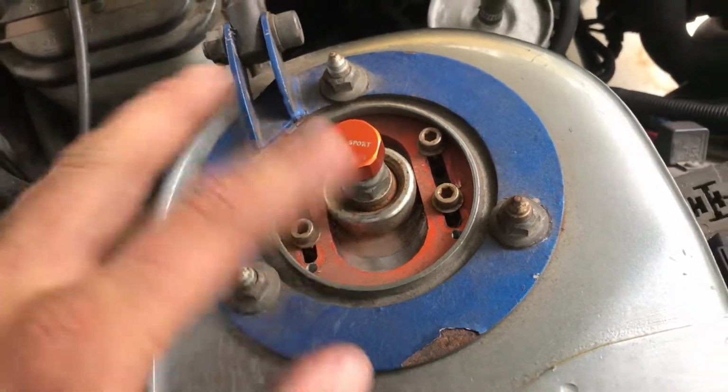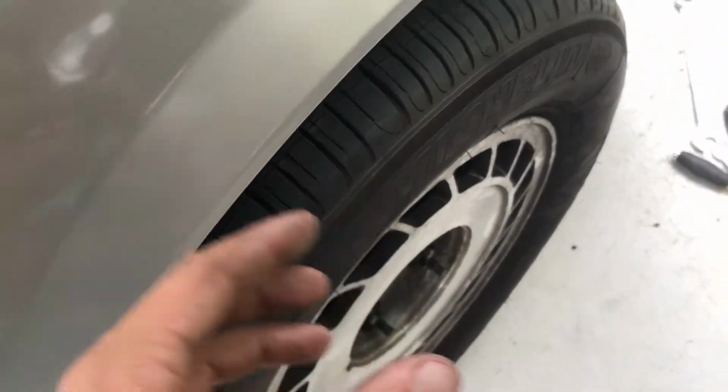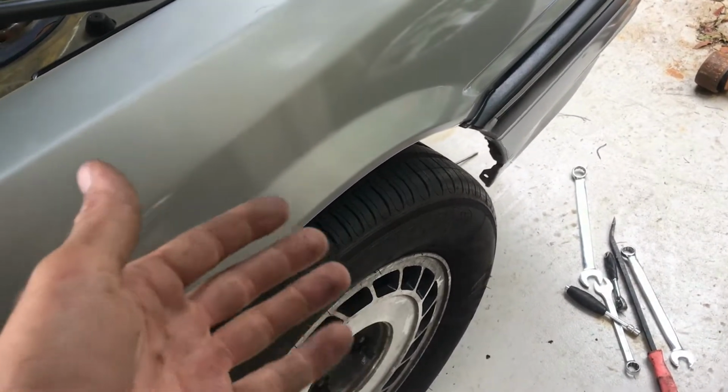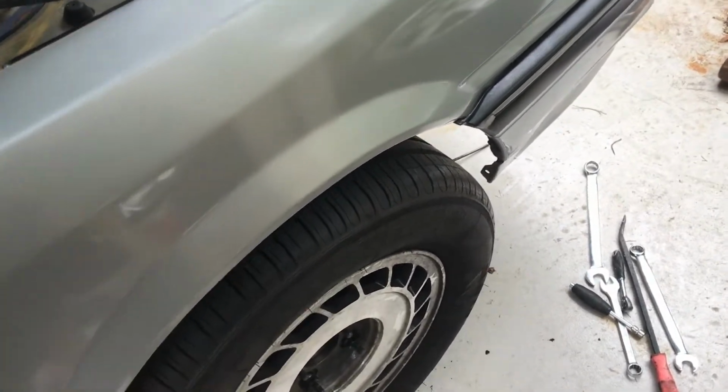R31, S13, blah blah blah. Too bad, didn't know, don't run it. Let's look at that, it's looking a bit better. So we're pretty close. I reckon if we jack this up, it might even just come in a little bit, and we can still loosen the coil over to the knuckle and move that around a bit, and potentially even get some off-center camber bolts or whatever you want to call them.